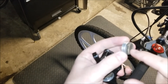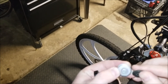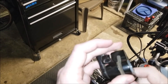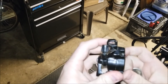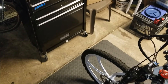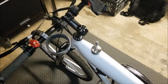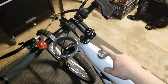If you look really closely, you can see this is how you adjust the pad and access it to change it. It's really beat up and scored, held on strangely by a magnet. At the shop they don't sell anything like that, and I would guess this whole caliper assembly is made out of some sort of zinc alloy pot metal — with enough time and braking, parts of this would just snap right off. It's very cheap, so I highly recommend to anybody doing high speeds on these bikes to definitely change the brake assembly and get rid of these.